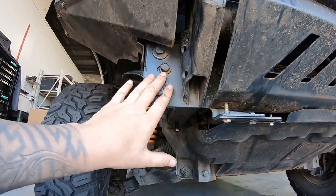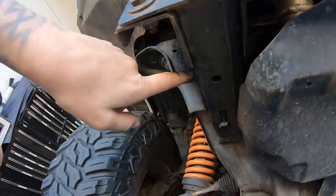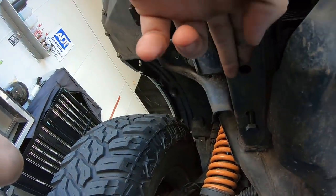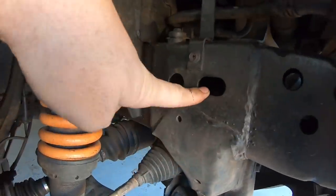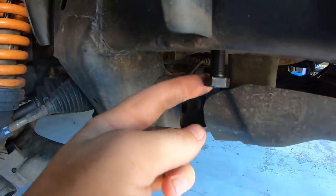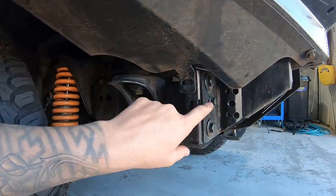Over on the driver's side, this is the hard section because the bull bar actually blocks off the front of this chassis rail. Normally there'd be a big hole where you could thread the rod up onto these two holes and hold the nut while you do the mount up. What I've managed to do is shave just ever so slightly the side off one of those plates welded to the nuts, put it through this hole here, slid it forward, and we're actually locked onto it. I've done one — I'm going to film doing the other one — and hopefully that means we don't have to take the bull bar off, because I've taken that bull bar off literally a thousand times and I'm not about to do it again.